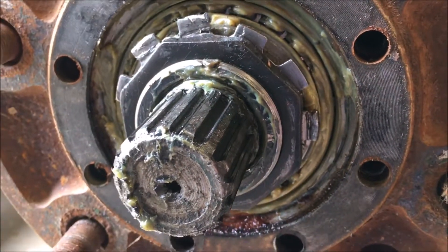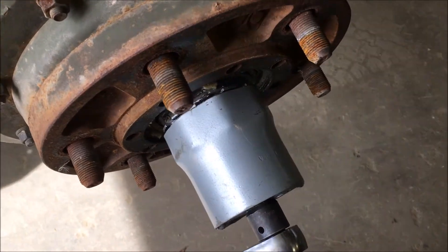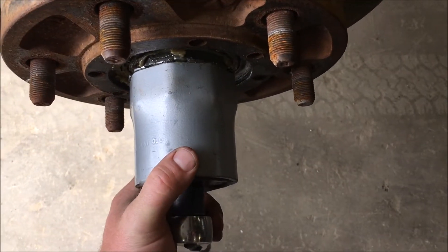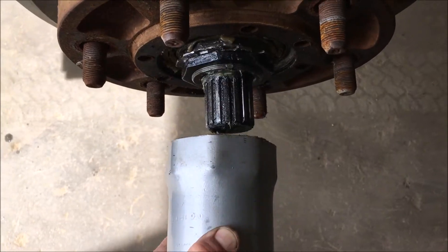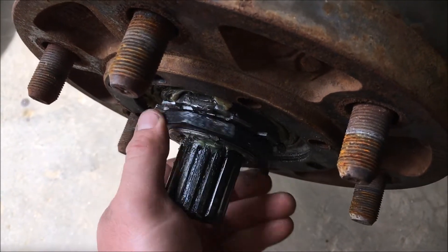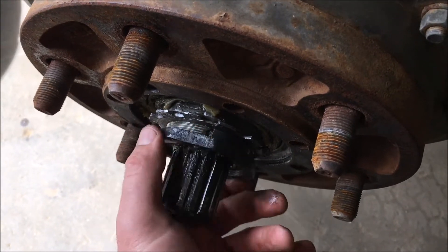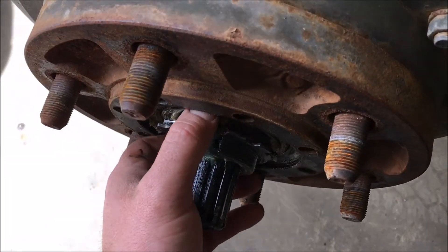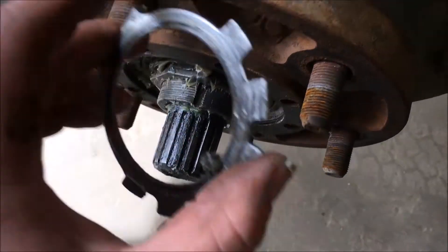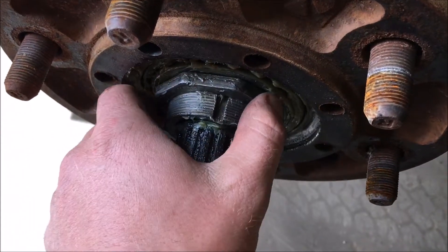What you'll need is a three inch eight point socket. The outer nut should be fairly tight, so it'll take a bit to break it loose. Once that's loose, spin the outer nut off. The lock tab comes off too. This back nut just sets a preload on the bearing so it's not too tight — even the weakest of guys should be able to loosen that with one hand.